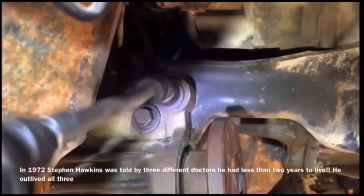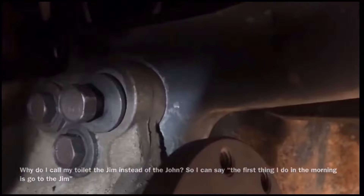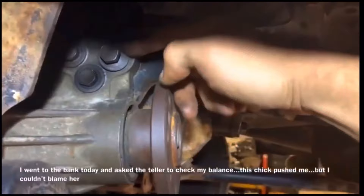Got a bolt that won't go all the way in. I'm suspecting the bolt is cross-threaded — it's just kitty-wampus off of there. So what we're going to do is slit the bolt so it will drive down all the way. I've got my bolt in there and that's as far as it's gonna go — it isn't going in there for anything. We need it to go down a lot further than that.